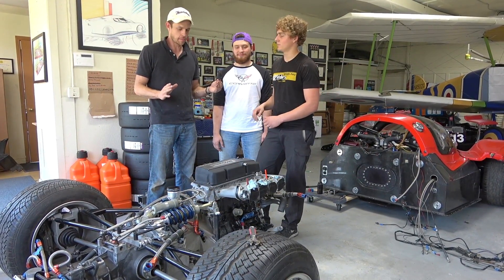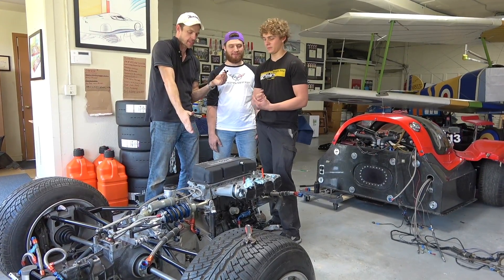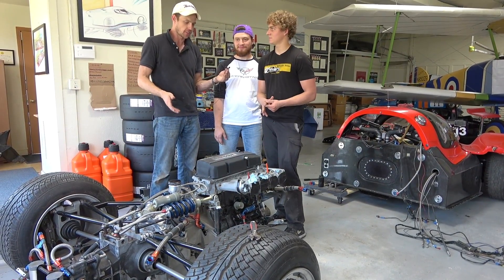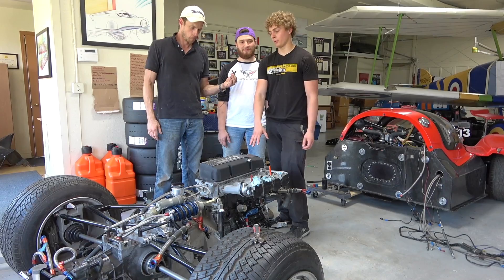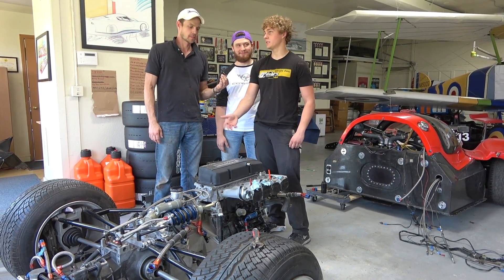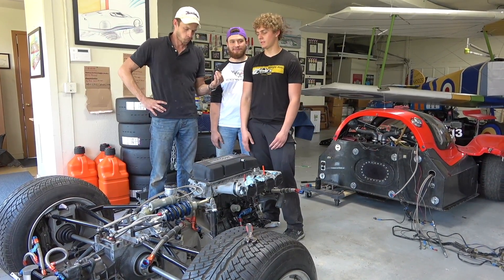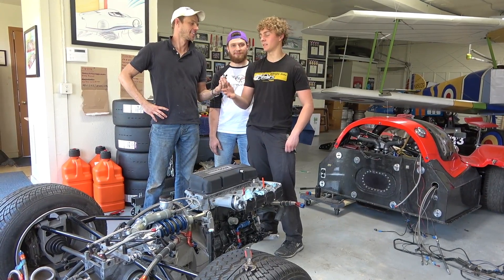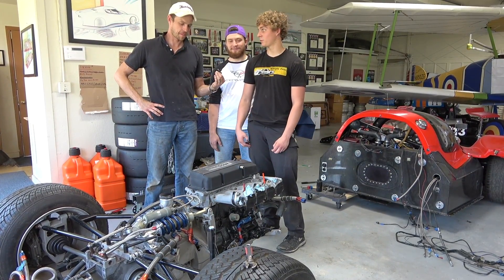What did you learn that got you excited? We asked him how much power the motor makes — we didn't really know the specs. We were going over it, cleaning up new bearings, checking hone, setting lash, seeing if it's trashed. What we learned: this motor is running on a 12.5 to 1 compression ratio — which is way up from stock. Are we good with 110 lead fuel? Yes — that's a good fuel for it at 12.5 to 1. These things are making 257 horsepower at 7,250 RPM and 210 foot-pounds of torque at 6,000 RPM. That's solid, on a naturally aspirated four-cylinder.